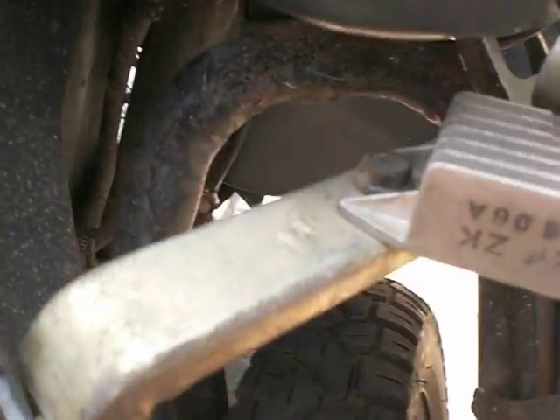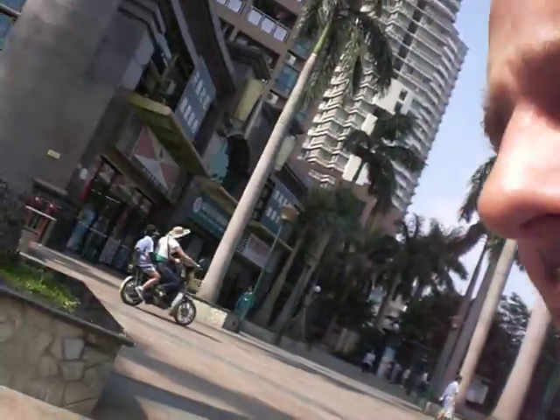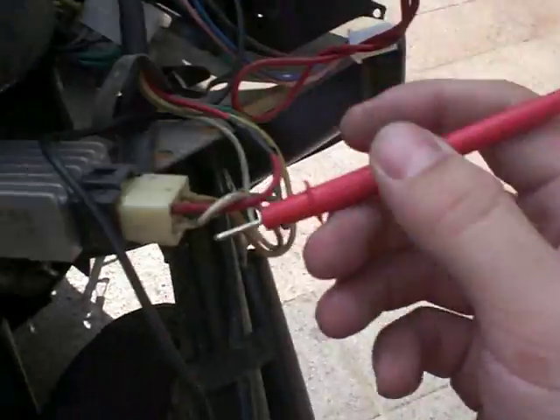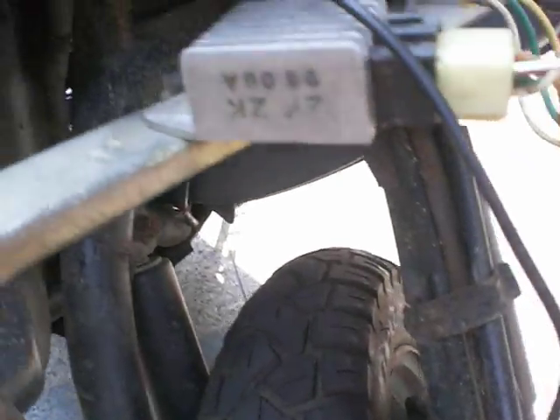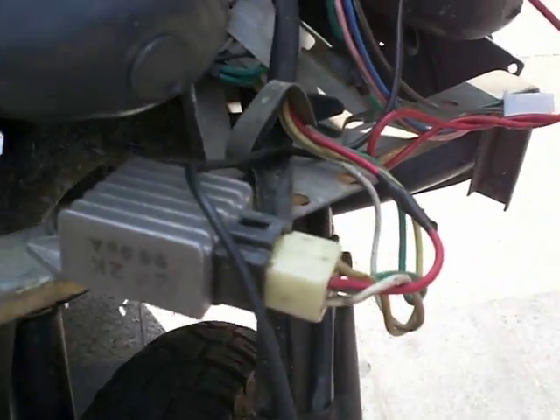It's on DC voltage, I'm going for the red one, and we're getting a good 13.10. So now you see it's charging — the voltage is coming through on the white and the yellow one, and it's coming out at a proper voltage on the red one. So that should answer your questions.